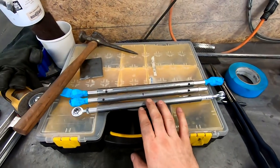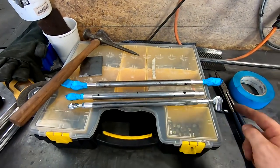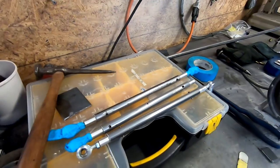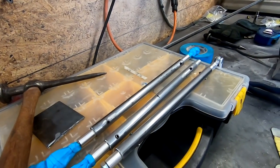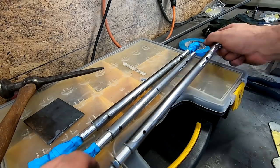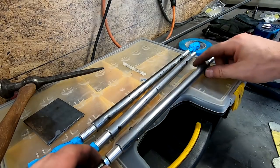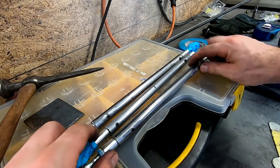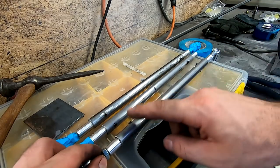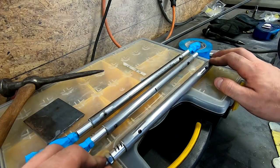Here they all are — I started taping them up because I'm going to paint them. I made sure the reverse-thread rod end is the slotted end on all of them so they're all the same. Quick compression test — holds it firm in tension but gives that little bit of give. These tension pins are in double shear with a rating of about 4,200 pounds so I'm not worried about them at all. That's about it for the splitter rods — we're going to shift gears and get started on the longer bump stops.